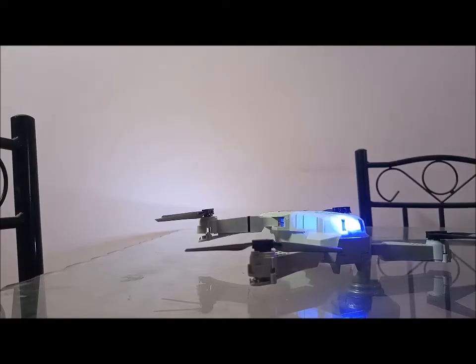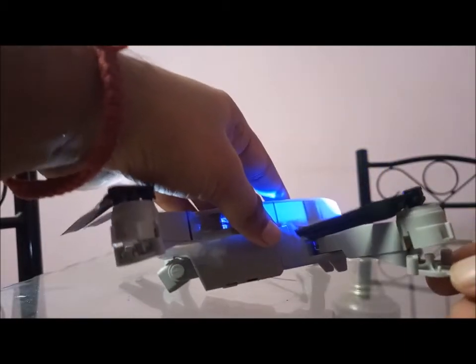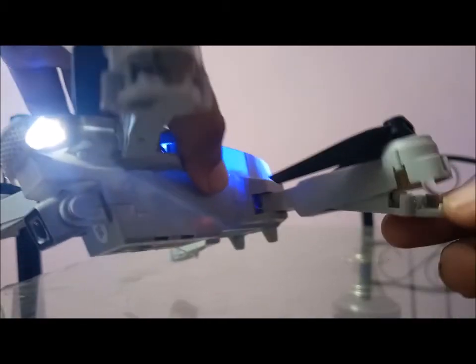I'm sorry guys, I need to make another part of the video to tell you about the motor problem. To test if the motor is fine or not, first make sure the drone is paired. Then you need to check which motor is rotating and which motor is not rotating.